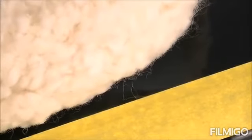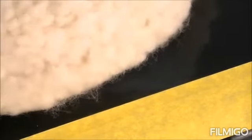Okay, so we can take care of that haze. First thing I got here is the rubbing compound. I'm going to use a wool pad. I've taped that edge off there just to kind of protect that edge so I don't burn through with the polish driver. And try to set it around somewhere between 1500 and 2000 RPM.